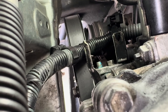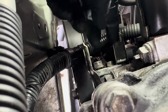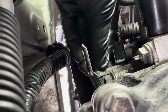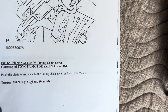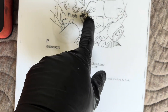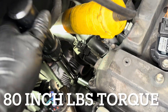Slowly tighten the two nuts evenly because you're screwing into aluminum with a gasket. These are the two brackets you pulled the wiring harness off of — the clips go right back here. Access really isn't that bad. We're in and I didn't hear any clicking sounds. The hook is sticking up, the gasket looks good — now we're pushing it in and reinstalling. Once it's tightened down we'll release that hook.